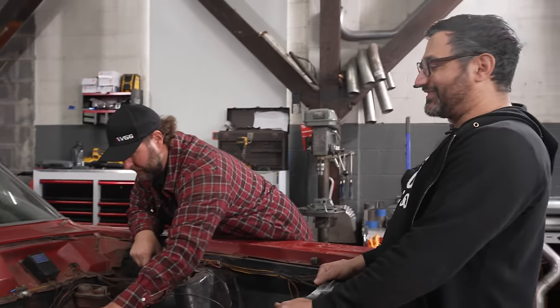See how long that is? I do. Where's your dial caliper? It's not even that. Look. The clutch is catching the bell housing. Sure enough. There it is. And so we'll see witness marks right there. Yeah. Clutch or flywheel? It's the clutch. Pressure plate. Right here. If you come on this side, you can see the witness mark. Okay. That little flap wheel action should be fine. Yeah, just get a roll lock.